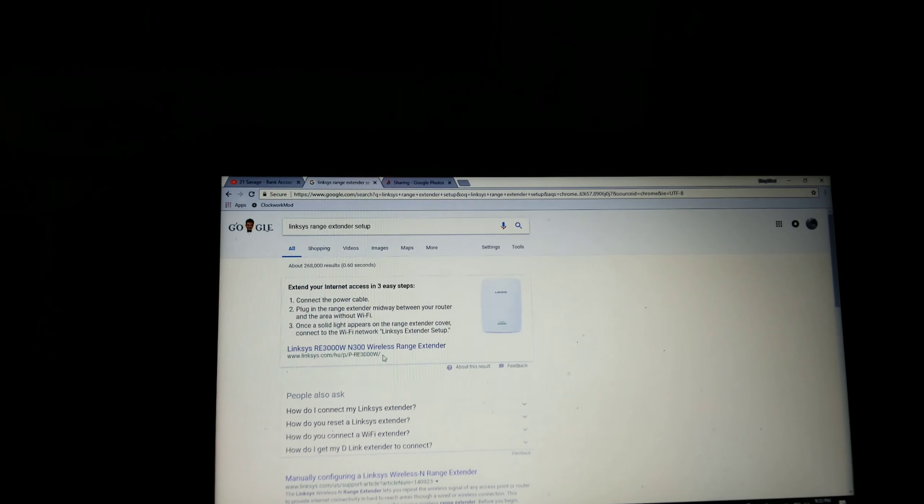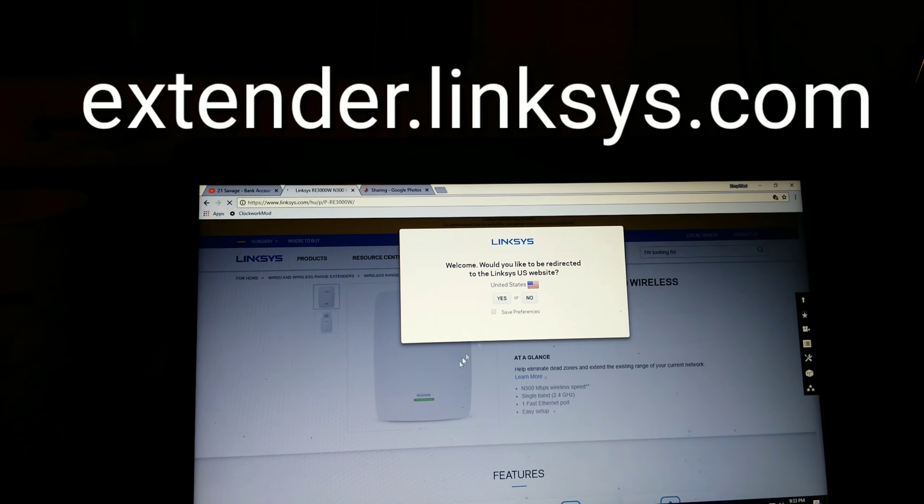What's up YouTube, so today I'm going to show you guys how to set up a wireless range extender. I started on this screen because your WPS needs to be enabled for this. I'm not going to show you the whole screen because it's going to give you my passwords. If you're at a new tab, the way you're going to find this would be your standard IP address, which you can find on the bottom of your router — it's going to be 192.168.0.1, and it may differ depending on your router.